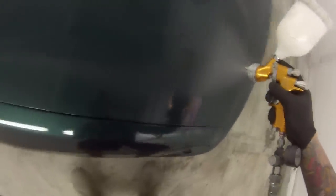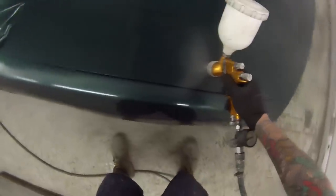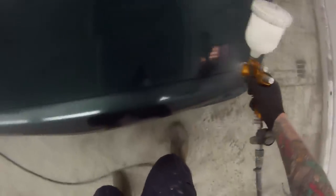It seems to me, because I bought that finishing line gun from America as well, that one doesn't have it. It seems to me like it's just an American thing. They don't have the air valves on the guns themselves. Guys over there must just run regulators on every single gun. To be honest, I run regulators on every single gun of mine anyway, so that valve just ends up sitting flat out anyway. So I wouldn't even need them. I could bung them out or just do away with them, and it wouldn't make any difference to my everyday spraying.